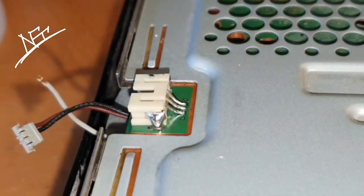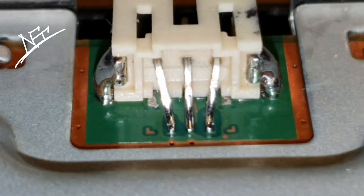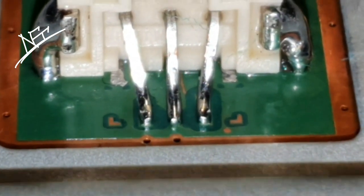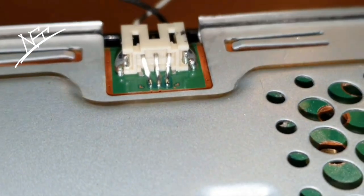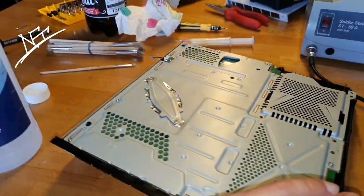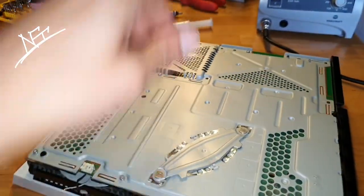Let me just clean it all and turn the PlayStation to the other side. Maybe it's just better to record it from here. You can see it now that this is all just done perfectly. Sorry that I'm shaking a little bit. But this is the way you can go and this will hold way better. I hope you like my work, guys. Now I need to make the cables longer here from the fan. A lot of practice and a lot of skills needed to do that so nicely. And that's why I just recommend doing that if you really have some soldering skills. Otherwise you'd better let someone do it for you.